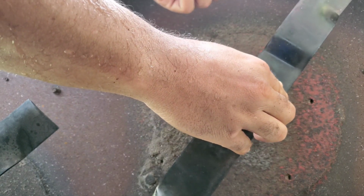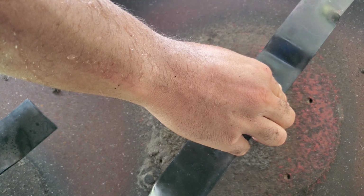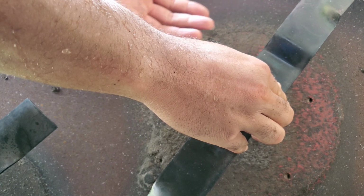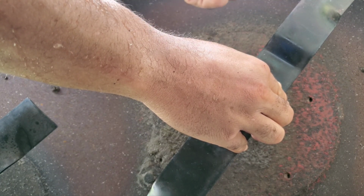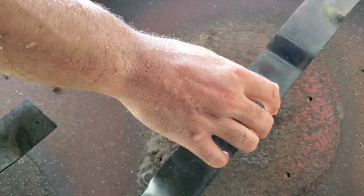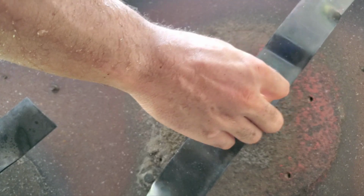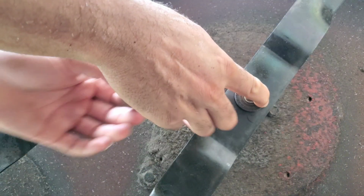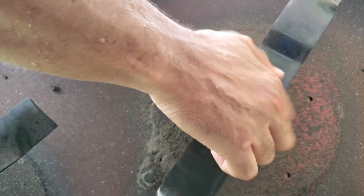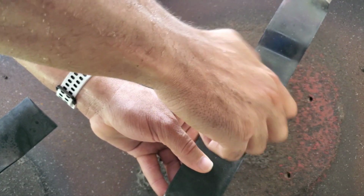Notice that I am putting it back at the same angle so that there's pretty good balance on this rotation. If you rotate counterclockwise, the blade will cut you, so remember that for the direction. You want to place the washers back the exact same way that they were on, because they are compression washers. They have a little bit of an angle to them, and they get good pressure on the blades so that they fit in there pretty tight.